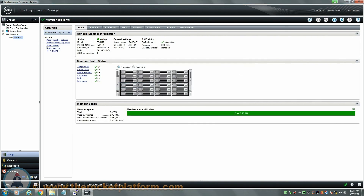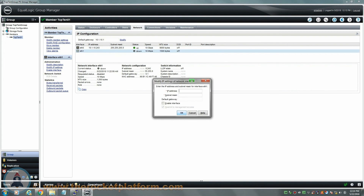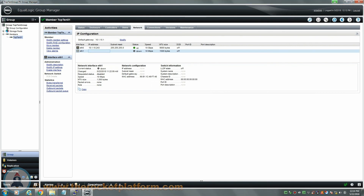Now that the RAID is initializing, you will need to configure the rest of the ports on the member. Navigate to the networks tab. In this tab, you will see a network configuration for this particular array. The port you had configured during the initial configuration will show up with the specific settings assigned, while the other ports will be grayed out with no information for either the IP or NetMask. Double click on one of the grayed out ports and a window will appear. Input the desired IP address and NetMask, then select the option Enable Interface. Select OK to enact the changes on the port. The port will now activate with the settings applied. Repeat this process until all ports are now active.